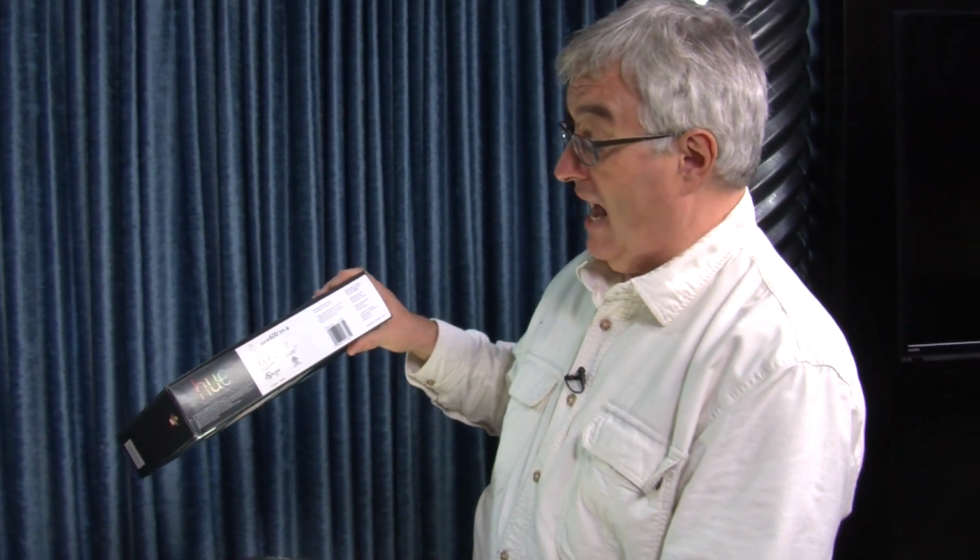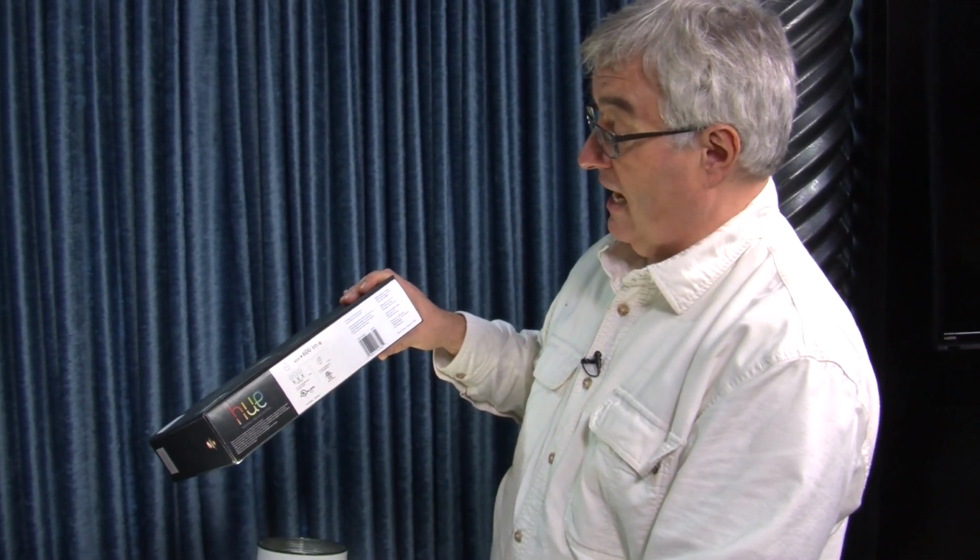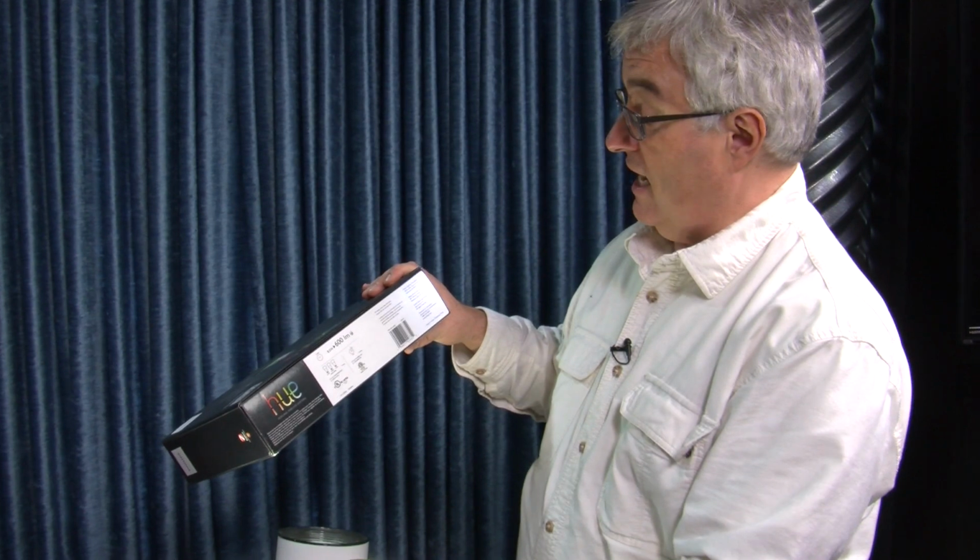The other thing to point out is LEDs last a lot longer than incandescent lights. Philips says you're going to get, let me just check here what they say, I think it's 15,000 hours out of these light bulbs. A good long time. You got 8.5 watts of use. That's another way you save, for about 60 watts of output. These are 600 lumens coming out at 8.5 watts, 15,000 hour time. This is using, as I said, Wi-Fi. It's 2.4 gigahertz using a Zigbee signaling protocol.